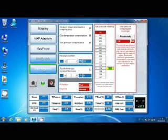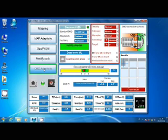Okay, next step, OBD Adaptivity. Here you'll find many new features. Let's start with the most important one, the selective errors erase. Enabling this feature will allow the ECU to erase some specific errors when they are still latent, so the MIL lamp, the check engine light, isn't turned on yet. This is done automatically by the ECU and only while we are driving on gas.